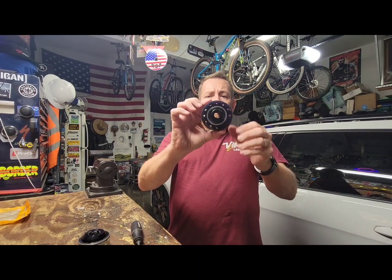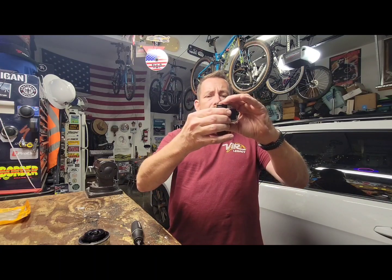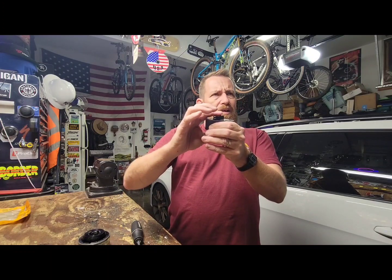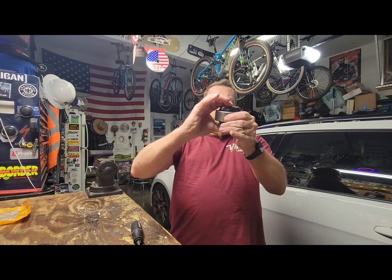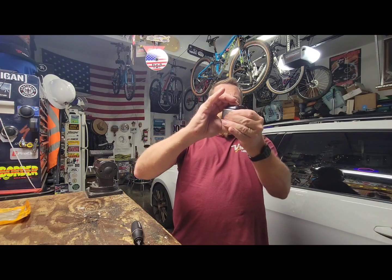There. It's a ball joint. So it's like a polyurethane-encased ball joint. It's easier to see here. Imagine the arm is cradled in the subframe. The arm comes off, there's the ball joint in the wheel, and it moves up and down like this. So really, the polyurethane shouldn't be stressed. The ball joint's doing all the moving. It's articulating, but clearly it is stressed because it came out. This one is in good shape. I'll keep it as a spare, but you can see if the arm was at droop and hit a bump, it would do this.